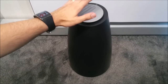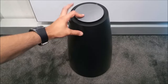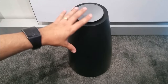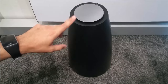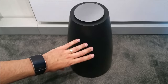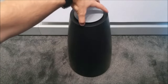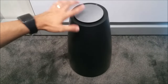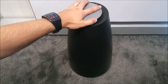At the heart of the whole thing we've got the Beoplay S8 subwoofer. This is an 8-inch ported subwoofer in a cylindrical cabinet — again very strong, minimising resonance. It houses the amplifiers for the two satellite speakers, which are two 140-watt class D digital amps, and it has its own dedicated 280-watt class D digital amp for the 8-inch bass unit. The bass port is vented through the top of the cabinet underneath this gap. The cover just comes off and you can get a cover to match the satellite speakers.